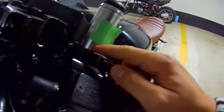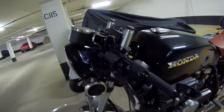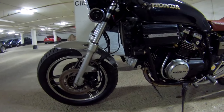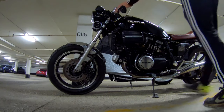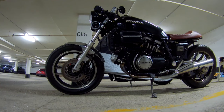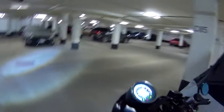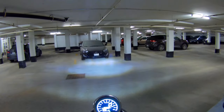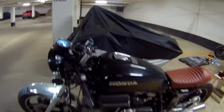Alright, so I dropped the forks about three quarters of an inch. So that's how they sit now — still not terribly high in there. I feel like there's still plenty of space for this thing to go under full compression, and we're still clearing the block at the bottom. In terms of the ergonomics, I set up the headlight so that it actually points in the right spot — it doesn't just point in the middle of nowhere. So low beam and high beam actually work properly. And I adjusted the clip-ons, so it's actually a lot more comfortable to ride.